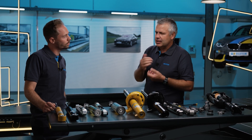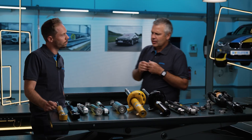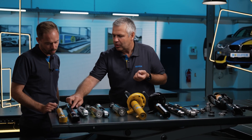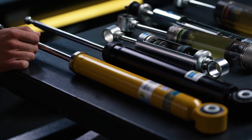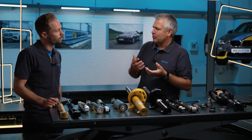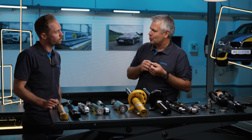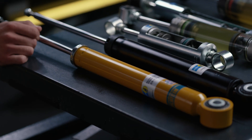It can be difficult. You do a test drive, experience a symptom, and then look at the system. If you can't interpret it exactly, look at the shock absorber itself. The outer shape can be slightly different — the tube may be tapered. That tapering may simply mean there's another tube inside, which is the working chamber, making it a twin-tube shock absorber. The monotube shock absorber is always cylindrical in shape because the working piston travels through the entire tube.